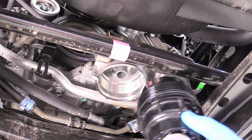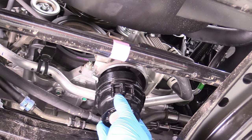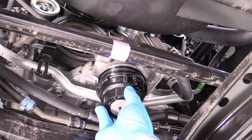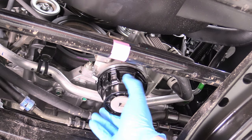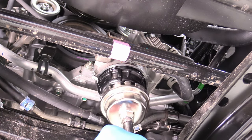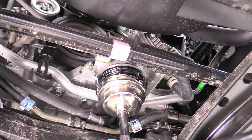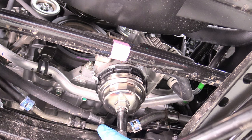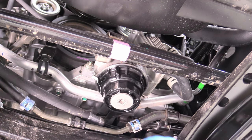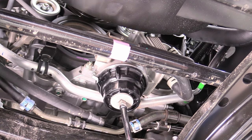Put the filter back, making sure the filter hasn't shifted and is still lined up and concentric. Make sure the o-ring is in its home. Make sure your socket is loaded up correctly with a nice good purchase on it. Tighten this down to 18 foot-pounds. If you don't have a torque wrench, just maybe one-arm tight is sufficient — it's not very tight at all. Then snug up the bottom cap too; that bottom cap is 10 foot-pounds. I'm just going to feel it out — I think that's perfectly good.